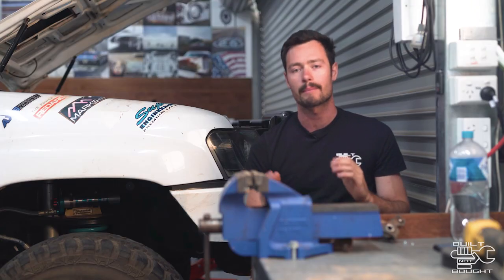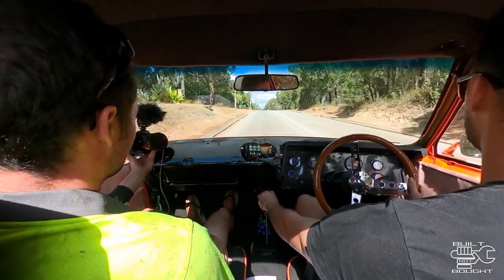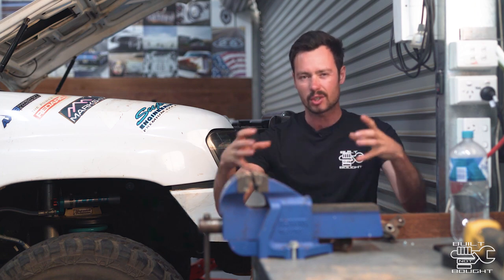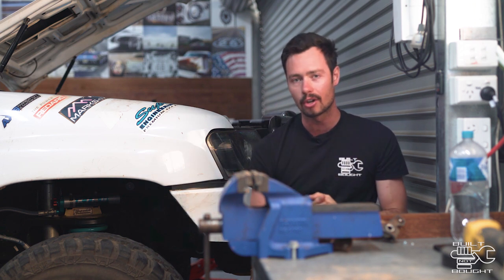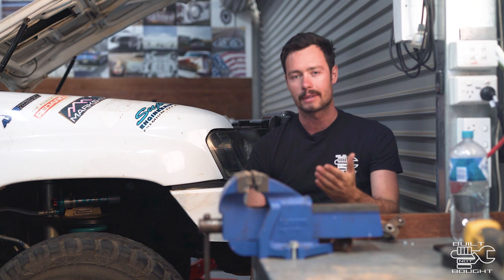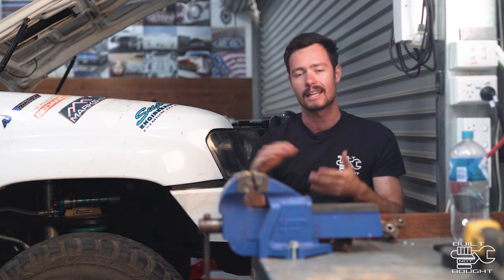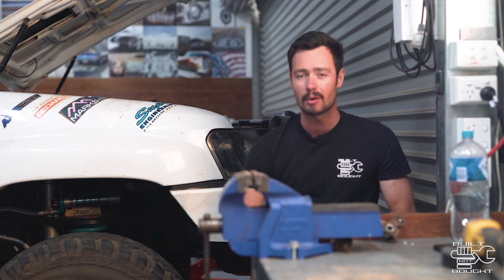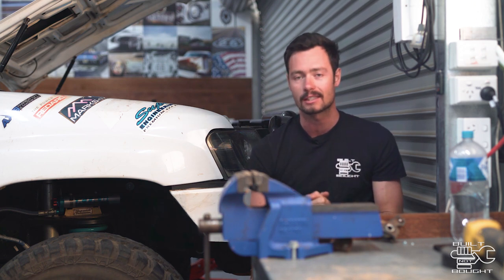So basically what we did when we drove up the hill — you want to short-shift the thing. Put it in a high gear and have the revs down low so that you can put your foot down. That forces a lot more fuel and air into the cylinder, creating a larger explosion, which creates more pressure in the cylinder forcing that ring out. That honing in the block will actually start cutting the ring. High gear, low RPM, put your foot down a bit — that swirls those rings out and really cuts into the block. Once that's done, you've got a perfect fit in each cylinder, no oil coming past those rings, and you've bedded your engine in. Now the thing's running, Zach can finish off everything else and get it over the pits ready for licensing.